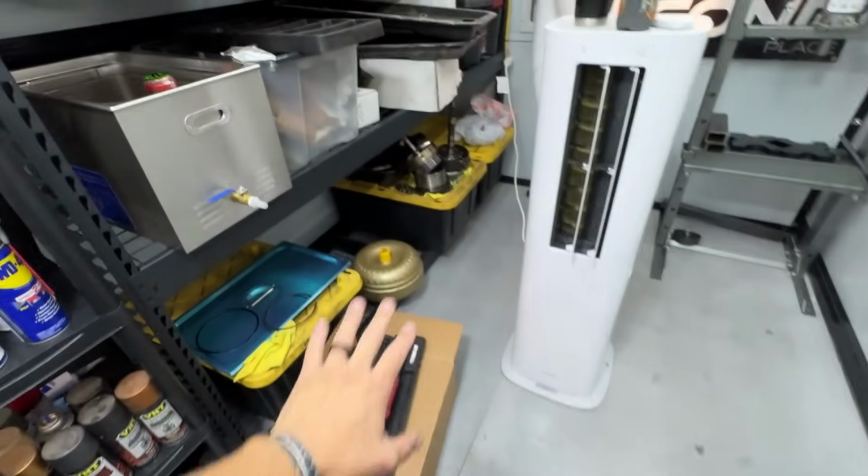The other thing that you guys might not have caught, I did size the pump bushing. That is something I've started to do over the last couple of years, where you put the bushing into the pump, and then I have just random converters laying around. I spin it on there, and you basically take a 3-stone hone, brake hone, and open it up. You want about 5 to 6 thousandths feeler gauge jammed down, and it should still turn.